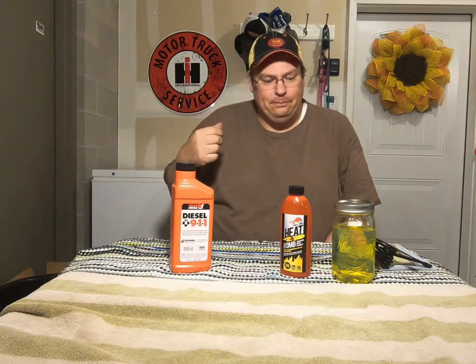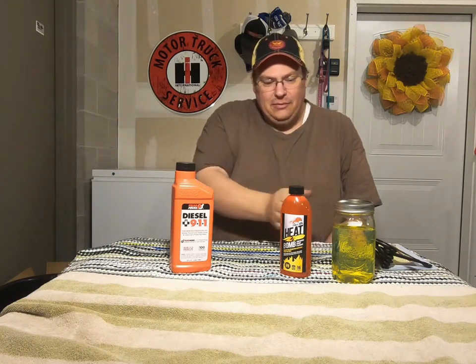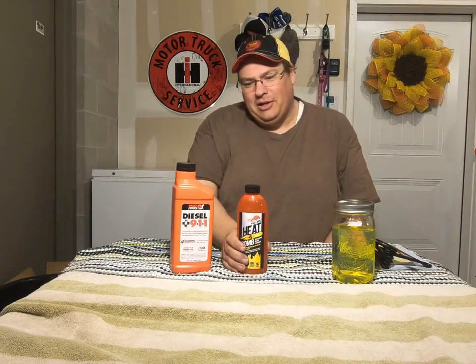I also have a jar of room temperature fuel so we can do some comparing. What we'll do is take the jars out of the freezer and compare them. I'm gonna try to be careful not to agitate them, because if this was in your truck sitting outside, you would just be applying this to your tank and your filters and you wouldn't have the opportunity to agitate it. So we'll put it back in the freezer and let it sit for about an hour and then check it.